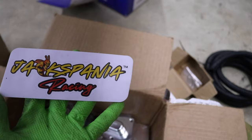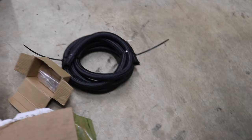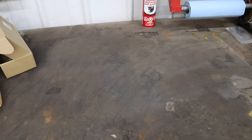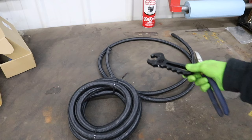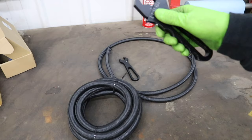Again, if you guys want to save some money and get 10% off, you can use the code Daniel10 at checkout. So while we're building AN lines, we are going to build two in one shot — we're going to build the 10 AN line and the 6 AN fuel line. For building AN lines you're going to need a couple of things: your AN line — this is 6 AN, this is 10 AN, and 10 AN lines are some beefy line. You're going to need an AN wrench if you don't want to scratch your fittings — this one is specifically a dash 6 AN wrench. I'll put a link in the description — I think it's like $20 Canadian and it goes all the way up to 16 AN, it's completely adjustable.